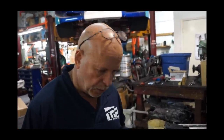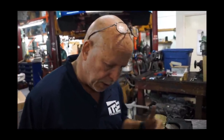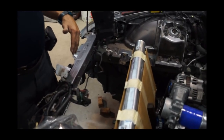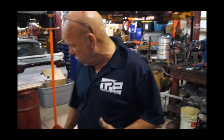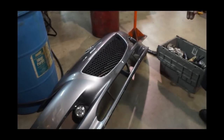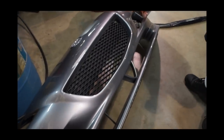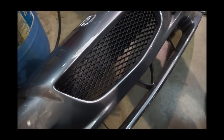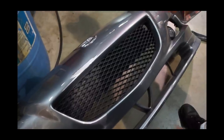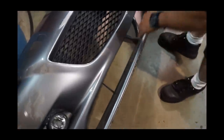Coolers don't matter because they have their own airflow. Most people end up putting, in most applications, the intercooler in the very front of the car, and that's really the way it should be done because you want the intercooler to have the maximum impact of air to make it more efficient. But the way that the front bumper on the RX-8 is designed may block off 70% of the air inlet of the car, and in reality, all the air comes in through this area right here.